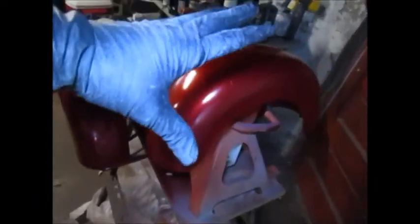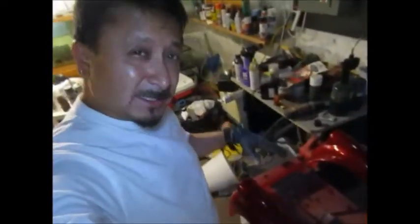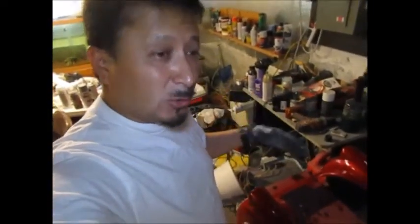This one is still ready to go, I can continue with it. The other one I have to hold on. What I'm going to do is take this off of here, take it all the way to the side - this is going to have to sit for an hour before I sand it. All I found was 400 grit so I'm going to wet sand it with 400 grit, but I'm going to keep going because I don't want all this paint to get completely hard.